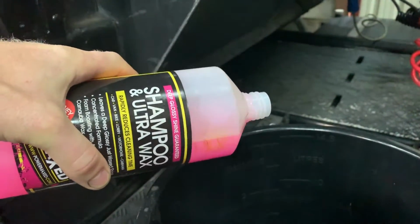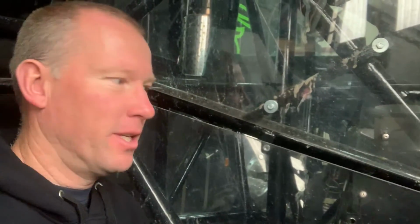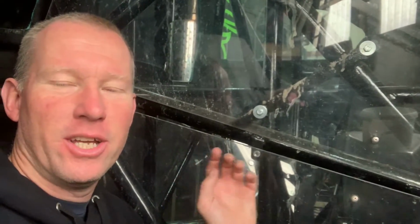So now we're just going to take all the Lexan panels off and clean them. We're going to use Power Maxed shampoo, just wash all the panels over with a big microfiber towel, and then wash all the tubes down. There's a couple of bits I have to touch up in there, because when we've had the cameras in there, they've put tape around all the joints and then put the clamps on to protect the tubes, which I said they didn't need to do, but the tape's actually pulled off more paint than they would have damaged anyway. But that's not a big issue, so we just got to touch up a few little bits where they've had the cameras in, and then start putting all the Lexan back in. So let's get on with it.